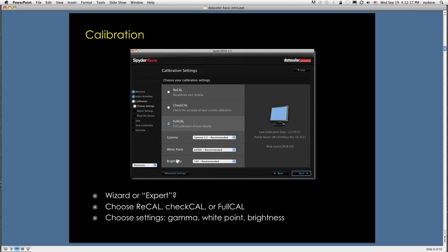In a brightly lit room, a screen set to 120 is going to look pretty dark, so you have to control your ambient lighting — get it down to the point where with the screen at 120, the screen is the brightest thing in the room. I strongly recommend that you have the room painted in neutral colors, cover a bright window, and if you have a light source, use a lamp behind you off to the side so you don't see reflections in the screen.